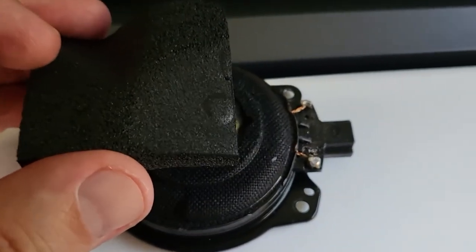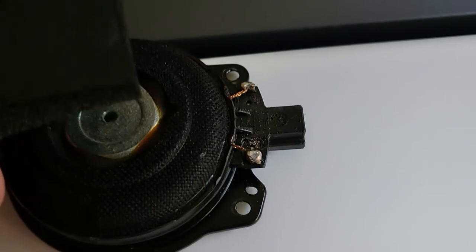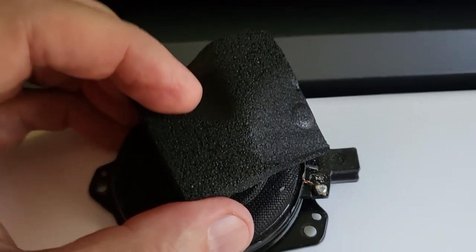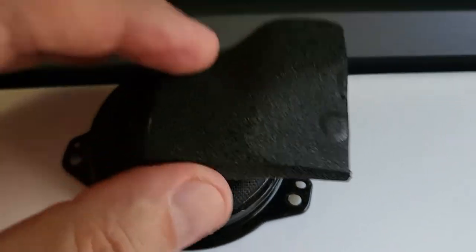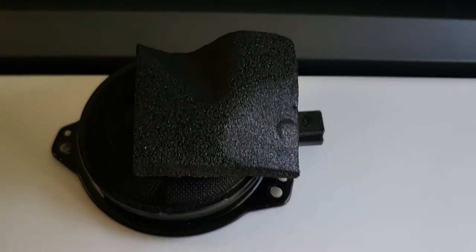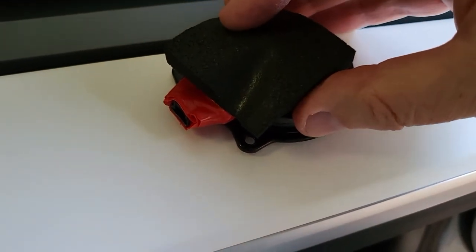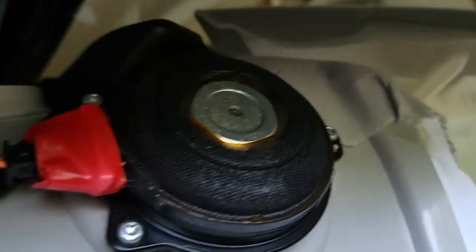What I'm going to do is put several pieces of electrical tape over just the two solder joints, which I filed down a little bit to get them smooth so they weren't as sharp. This piece of foam I'm going to be sure to place all the way over the tube — it was kind of cockeyed when I took it out, not placed properly. If it had been placed properly it might not have even happened. A couple extra layers of electrical tape plus the stock foam on top of those two terminals should keep them from grounding out on the metal.